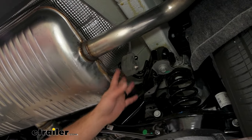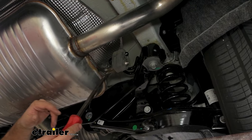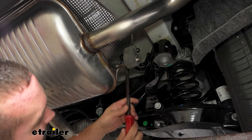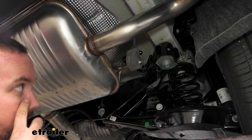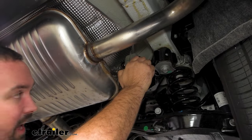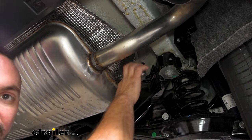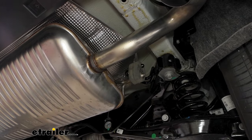On the passenger side we're going to need to pry off the isolator — it doesn't have that bracket. Pretty easy here, just with a pry bar or a long flat-head screwdriver, use leverage to kind of get this to pry off. You can do the top or bottom, it doesn't really matter. Sometimes these can get kind of tricky and won't want to slide on the isolator, making it a little harder to get off. If you need to, you can spray a little soapy water solution — that'll lubricate it and make it nice and easy for taking it off and also putting it back on later.